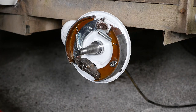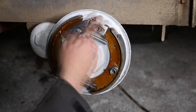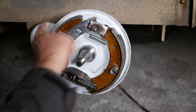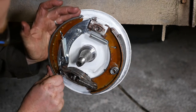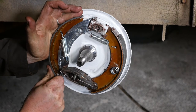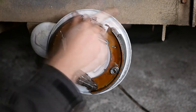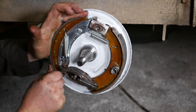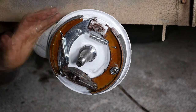We will need to clean the brake pad material now. When the drum's going forward it creates a wedge effect, and then as it goes backwards this slipper shoe will rise up on the pressure of the spring and allow the brake to come off. That's what happens when you go backwards — hence auto reverse brake.